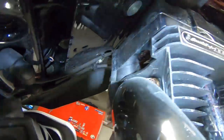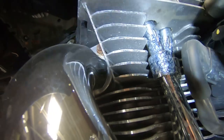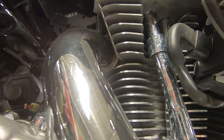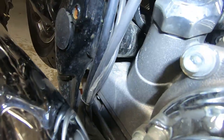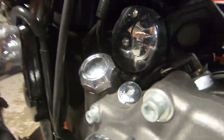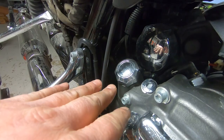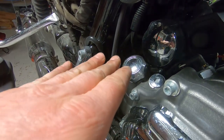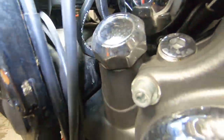Same thing - we want to look around the rear cylinder head, the rear rocker box gaskets, and the rear exhaust flanges. Make sure the nuts are on there and nothing weird and crazy is happening. I like to look down behind the oil filter because the back of the transmission comes down and goes back quite a few inches under the swing arm, and a lot of times I can find stones, nuts, and bolts that get jammed up in there. Looking way back deep - everything is looking good and clean here, nothing unusual.